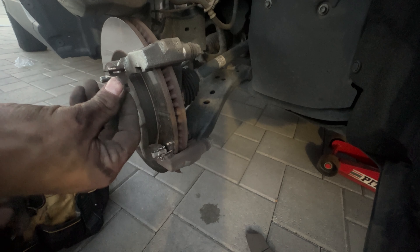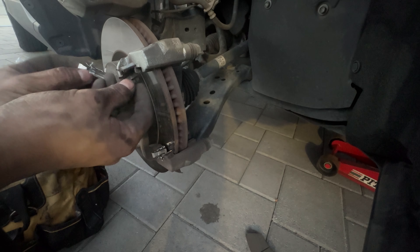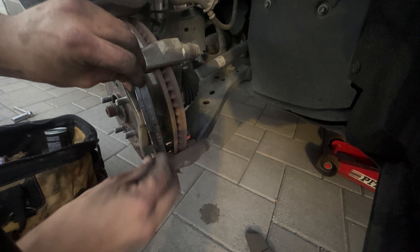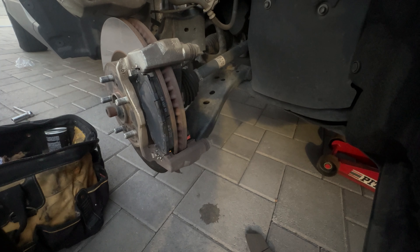This is one of the cars we use on a day-to-day basis and I can work on it easily. Match the shim up and put it in the placement it came off of. Then put the new pads in. Once you put the new pad on one side, go ahead and repeat the process on the other side.